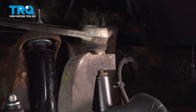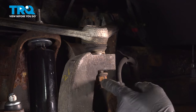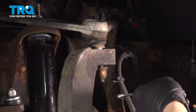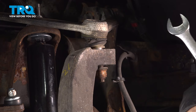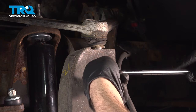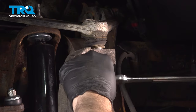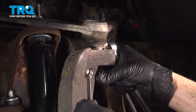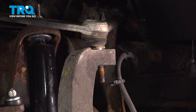This is spinning with the ball joint. We're going to put a wrench on the bottom here with a wrench on the top to finish loosening that completely. We're using a 10mm on the bottom and a 21mm on the nut. Go ahead and remove that nut and set it aside.